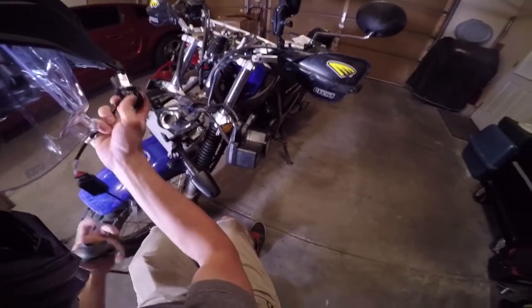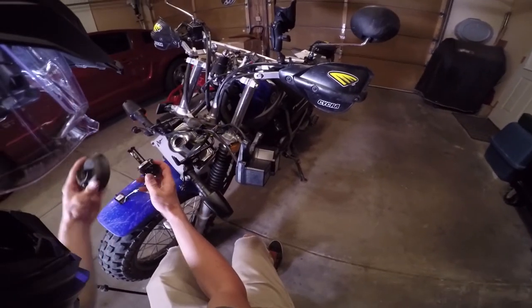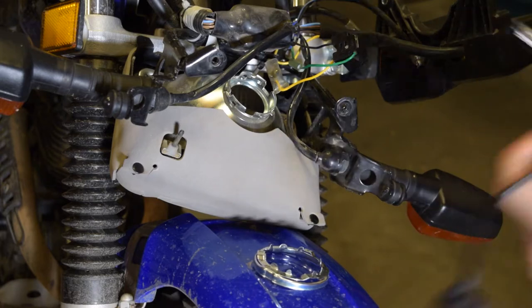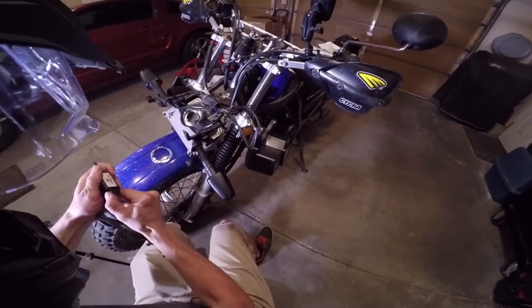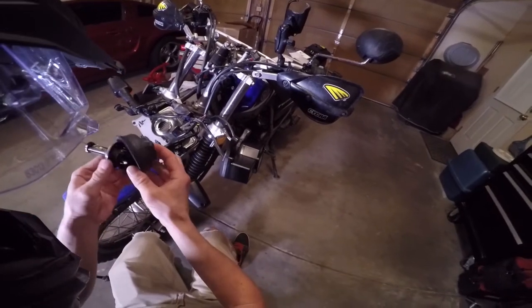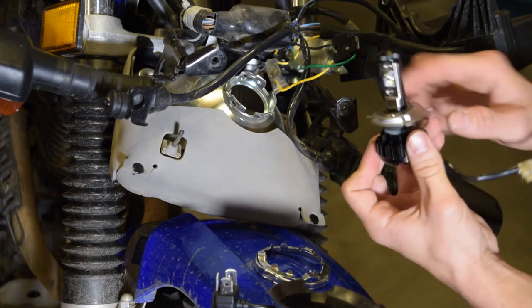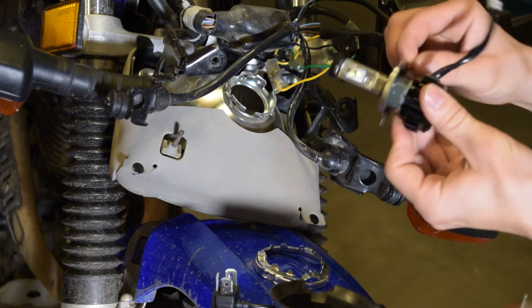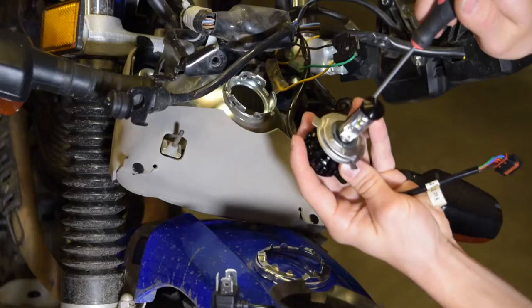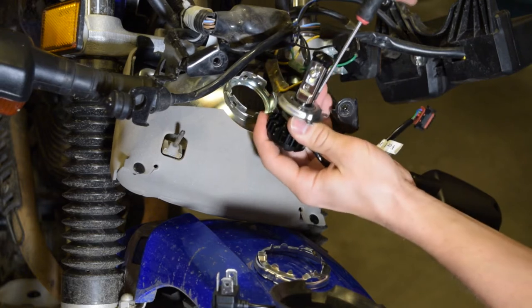One thing you're gonna notice if you try to put this together is that this rubber boot is not gonna fit, even if you disconnect it from the module, because it's gotta fit around the fan. You would have to stretch it a whole lot. It's not gonna really fit around the front, but if you notice on the front, there's two little screws that hold this metal adapter on there. And if you just take a really small Phillips, you just take those screws out.